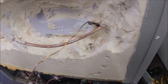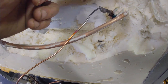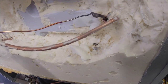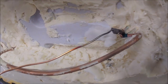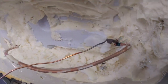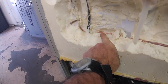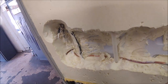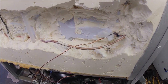What I've done now is taken that little piece of aluminium that was joined onto the copper, cut it off, cleaned the copper, and put a capillary which I've inserted about an inch in and welded on. So now we're going to start by feeding this side back to the freezer on the other side, and this one I will run up to the cold plate which I'm going to fit later on. So far everything looks good.